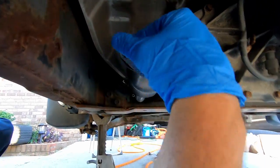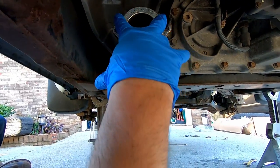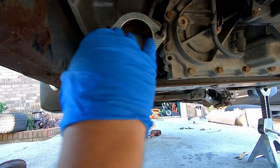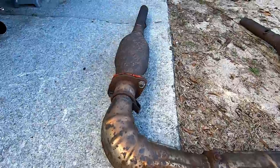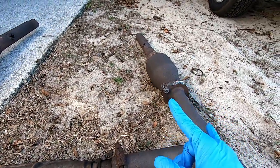So I thought that the exhaust system's fitment was whack. The Amazon unit, but I got the old exhaust system out and I made a discovery. So I want you to know just how on these catalytic converters, how flat that's sitting. You see how these bolts are sitting pretty much flat headed to the ground, right? They're even across this way. Here's my old exhaust, and if you look, you notice how these are cocked to the side. And the same over here.